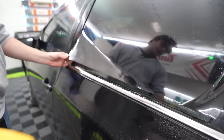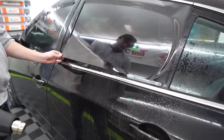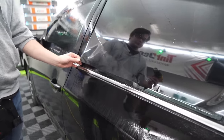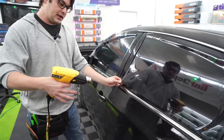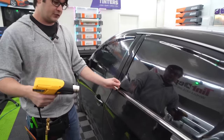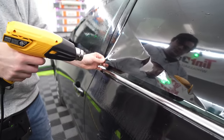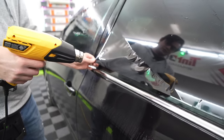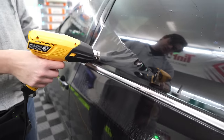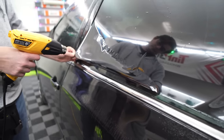Pick it back up and get about three or four inches away from where it starts to swoop up off the glass — just that area in there. Take that heat gun, point it right at the bottom. You can start farther out and work in — you don't have to go full bore and move really fast. You can do this very gradually. Keep the heat gun farther out and start moving it closer to about seven or eight inches away from the bottom of that window, and just start moving that heat. All you're doing is letting that tighten up.